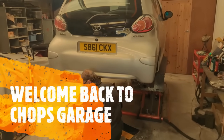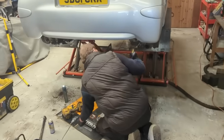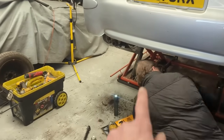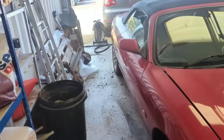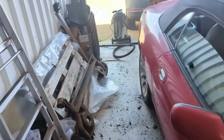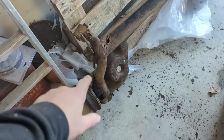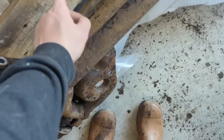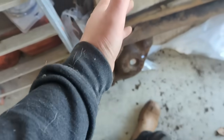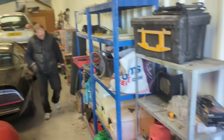We've got Pete in today and we've got the Aygo up on the ramp to change out that rotten rear beam. If you remember, it's got a rotten rear spring pan. There's another one over here that I've just been wire brushing down. Worth covering while we're talking about this - what it means when people say there's surface rust underneath cars. This is a used rear beam and as you can see it is rusty, but it is actually solid. That's the test of whether it's solid or not - just my finger going like that. That's a certifiable industry standard.